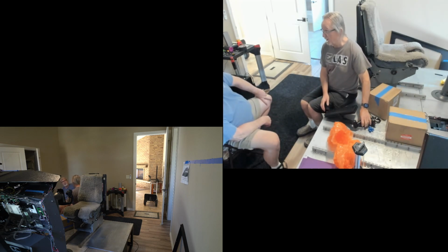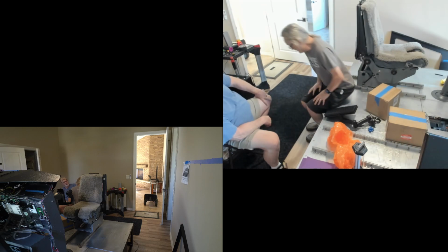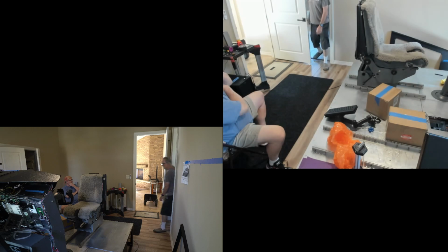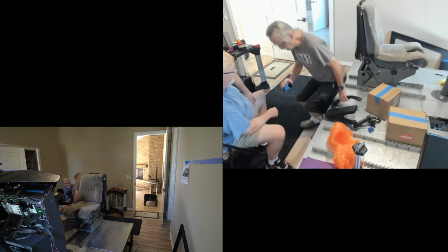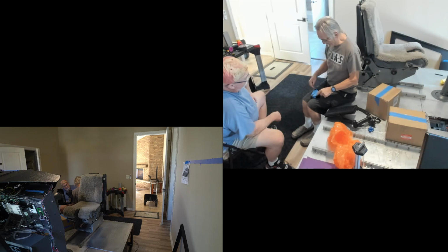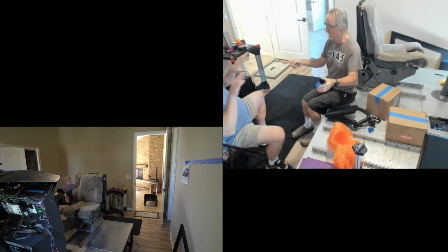I'll be honest with you. Yeah, and just cut out a panel. What you use behind it is these things. Let me show you what you use behind it. These. So in the nose, this is what they use on the access plate. Once you cut the hole out, you get these little flat plates and you mount two holes on the inside, and then you just screw right into the plate.